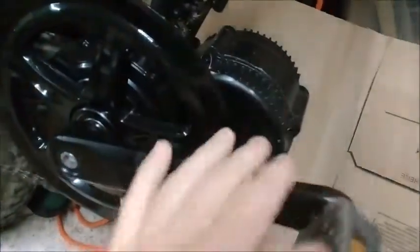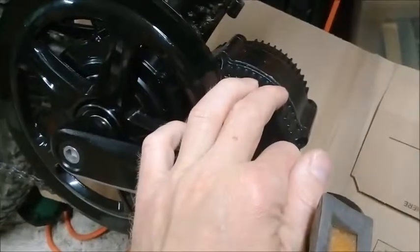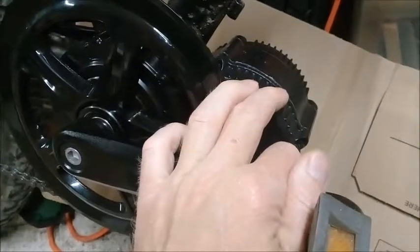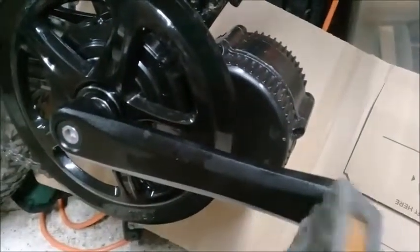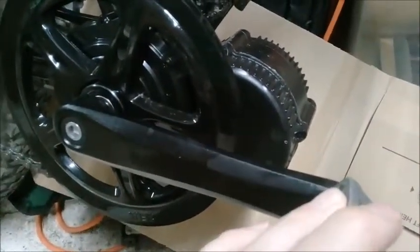I don't think I'll play around with the amperage, but going out on yesterday's first test ride I noticed a few things that weren't great. Mainly the pedal assist is good but could be upped a little bit, and also the power. I'm going to release a little bit more power with the programming, so when I get my cable I'll show that and do another video. It just needs a slight improvement — there are quite a lot of hills around here so we're going to change the settings to improve that.